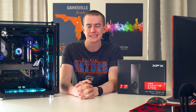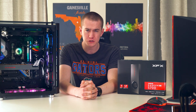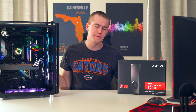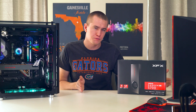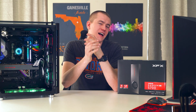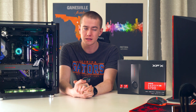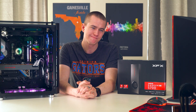As I mentioned at the beginning of the video, we're still waiting on EK to send us the water blocks they've now announced for the 5700. We're going to try to see if we can get some more juice out of it once we decrease the temperatures by quite a bit. But I'm actually not that impressed by this — an average of 1% increase over max overclock, which was super easy to hit at 1,850 megahertz — just hit the slider, hit 20%, apply, ran flawlessly. After everything was said and done with the power play tables, we're hitting 8% over stock but only 1% over the max overclock without the power play tables. So I honestly wouldn't recommend that you touch these things for the 5700. It seems like the 5700 XT has a much better time with it, and we'll be doing a video on that as soon as we get our card in.